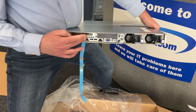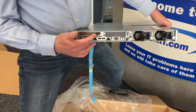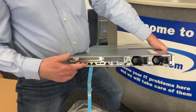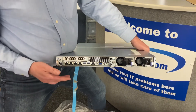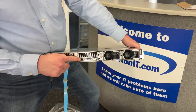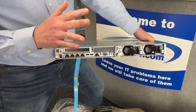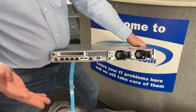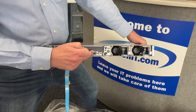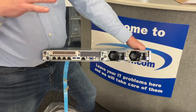These four ports over here are used to manage HMC's remotely. So you might be managing a single server from each of these, or you might have a dozen on this one, none on another. You can manage up to 48 physical servers and about 2,000 partitions, if I remember correctly. This one over here is a special one that allows you to remotely control the HMC when you are not here. So if it's in a data center and you VPN in from home, if you connect to this one, you'll get the equivalent of the power button, the video, and the USB keyboard and mouse — so you can literally turn it on or off as if you are standing there when you're remote.